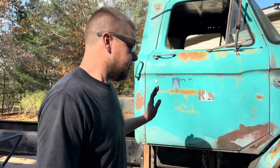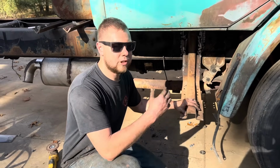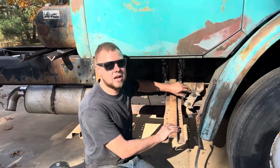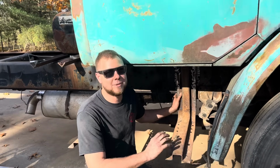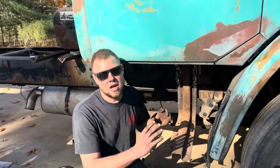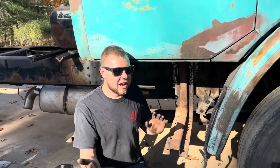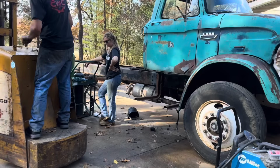But anyways, without us talking about shoes, what I've got going on is these are the 1965 Ford gas tank lowers. We took the '95 Internationals off and put the '65 ones on there. The problem I ran into is that with these setting up against the frame, they hit this leaf spring shackle. So I took some 2x2 angle iron that I had left over from the Snap-on truck and welded it to the back of it, and then we're going to weld it down the frame. But before we do that, we want to make sure the fuel tank fits. The reason I know where these go is because last night when you guys weren't around, I was messing around with the other side, and that side located this side.